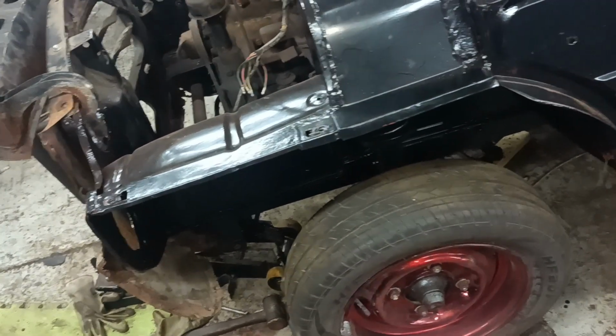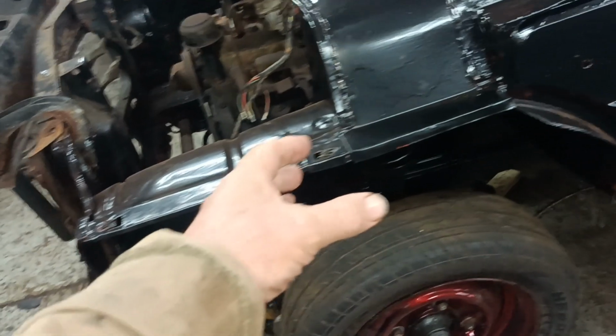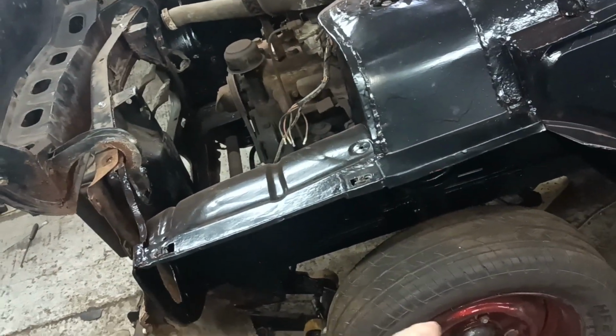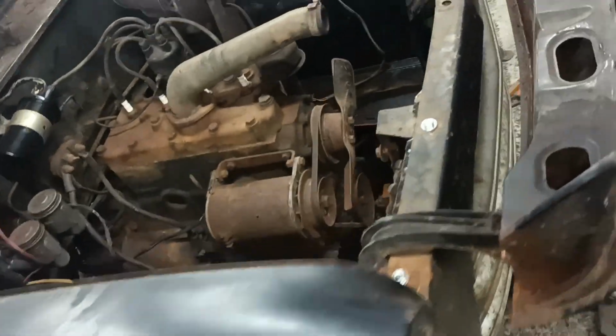Some of it only temporarily, like putting the wheels on, but both struts built and fitted, all the front suspension reassembled with the new bushes, including retrofitting one that was supplied incorrect but then supplied correct, so I've got that one in today. All the steering has been cleaned up. You can see one of them down there, look. All the track rod ends all cleaned up and fitted and freed up and made sure they work. I fitted the brake back plates and I fitted one of the hoses, and I've got to fit the hose on that side. And then I lowered the car down onto its wheels so that I could load the suspension to be able to assemble the front of the suspension, which I have done. So yeah, a lot of work over the last few days.